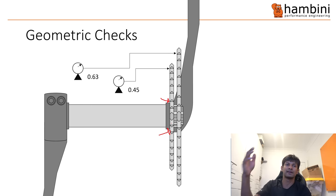Gear ratio availability — I alluded to that earlier. And the DBCA on some axles: the distance between the bearing contact areas on some axles is quite small and will limit what bike you can put it into. And finally, the instructions are terrible. If you've got any questions or comments, please use the comment box below. And until next time, keep banging your hairdresser.